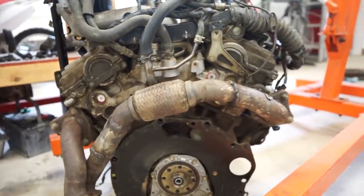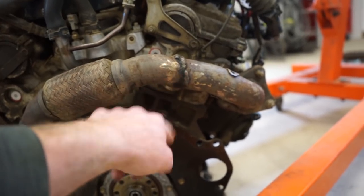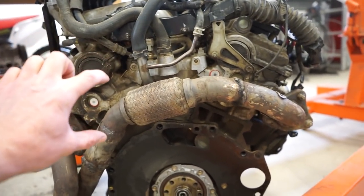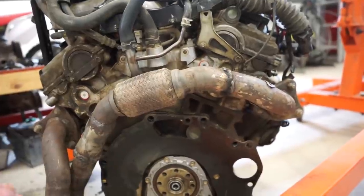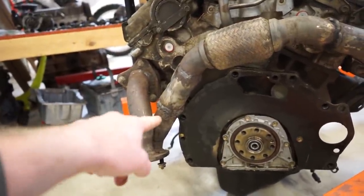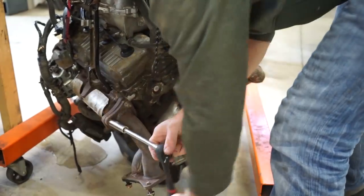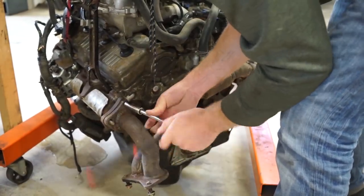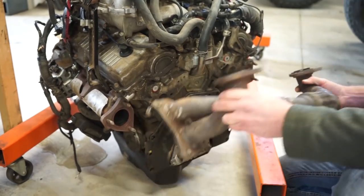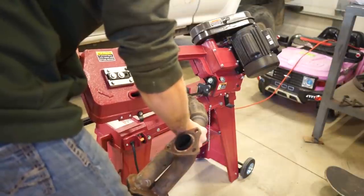I think I'm going to get started on this crossover pipe. What I'm going to do first is move the flex joint over this way, cut the weld out — probably here and here — and get that flex joint more straight across on the top. That's kind of how I've seen all the aftermarket companies do it as well. Then I'll have to figure out what kind of bends I need to get down to that flange and still clear the transmission.